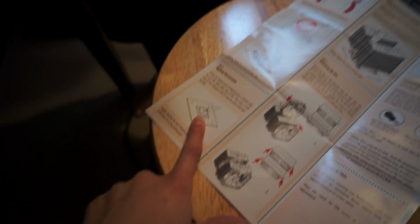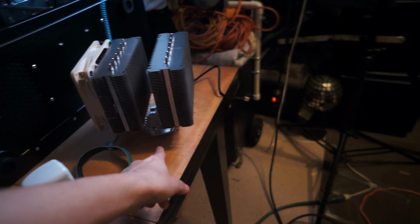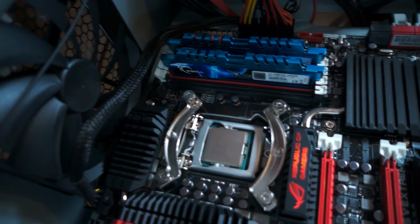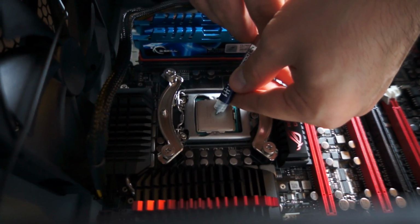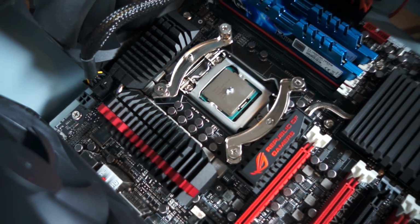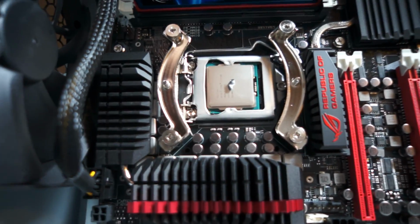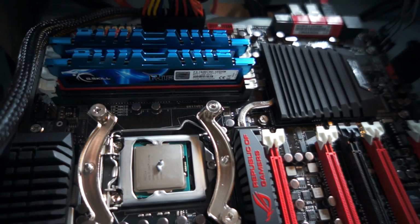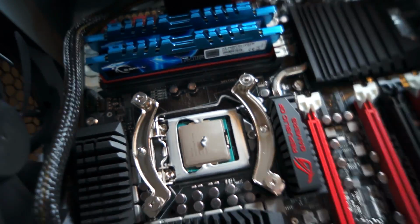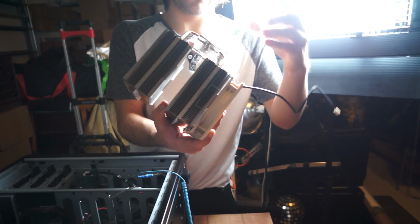We have to put the thermal paste on. Then we have to fasten the heatsink, and you have to take this thing off the bottom of it first, obviously. Then you have to screw it down. Here you go, I'm just going to put a little dot right in the center. I feel like that's perfect. It's kind of like a double Hershey's Kiss. Maybe a little bit too much, but I think it's fine. I think it's supposed to be a smaller dot than that. I swear, it feels like it's not coming out, and then once it does, it shoots. Should I take some of it off? It's probably fine. This happened last time too. I was like, it's too much. It's fine. All right, next time.